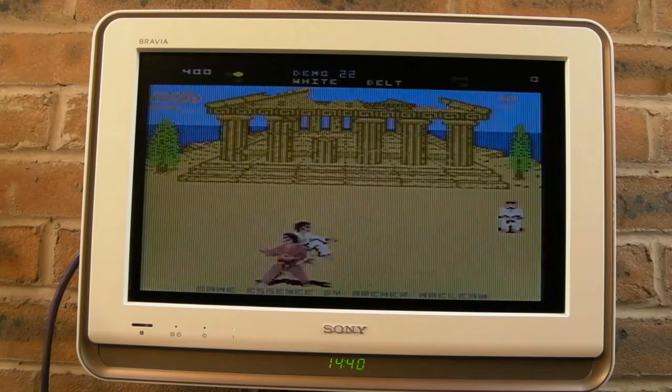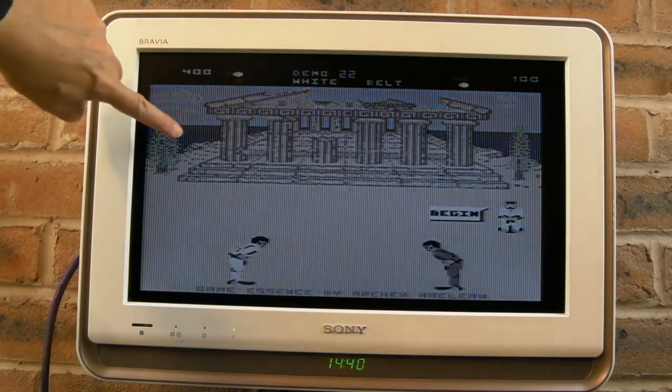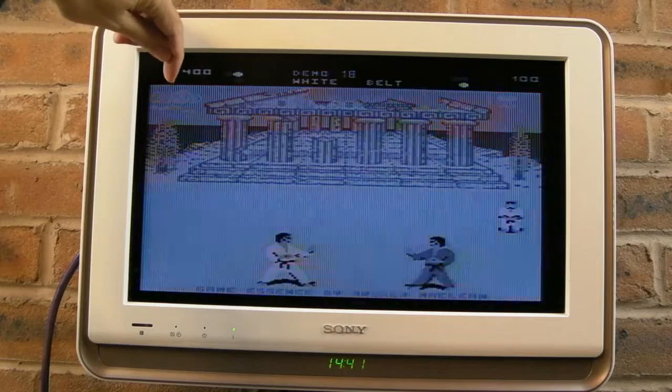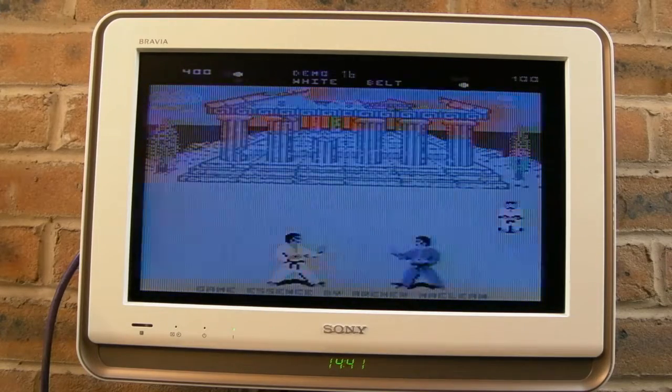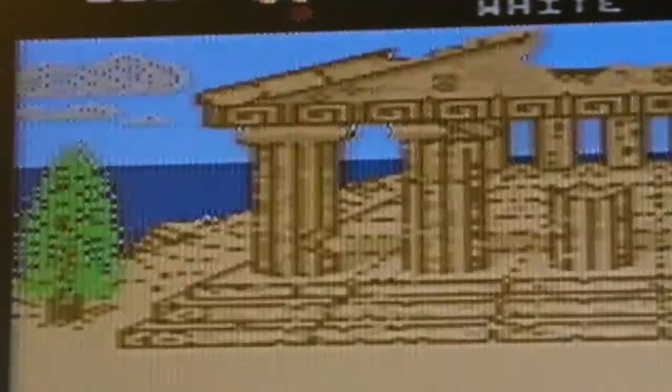The interesting thing is here, and it's a bit telling, it's not just colour. The colour's going, but just look, can you see we got a line? It's like you get a line, not a line, line, not a line, a line, not a line. So, that is interesting. Let me zoom you in. Yeah, hopefully you can see there what I mean. We've got lines, it's like jail bar, no jail bar, jail bar, no jail bar. And when we see the jail bars, we lack the colour.